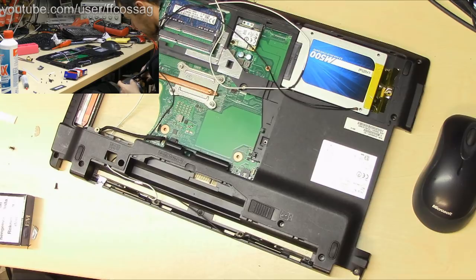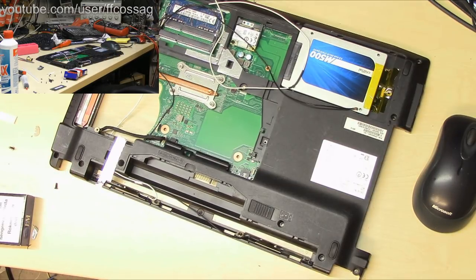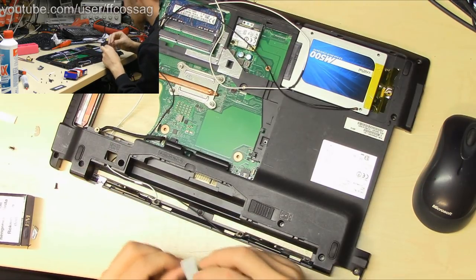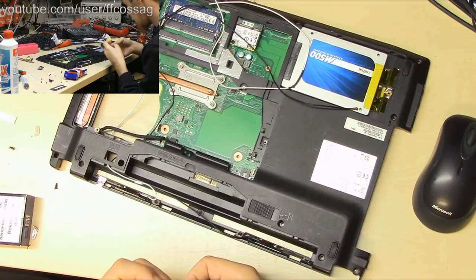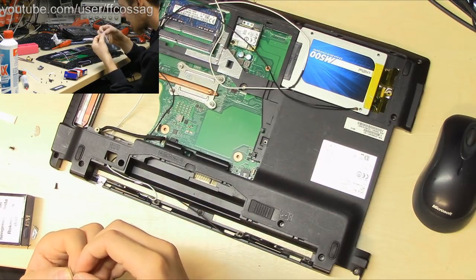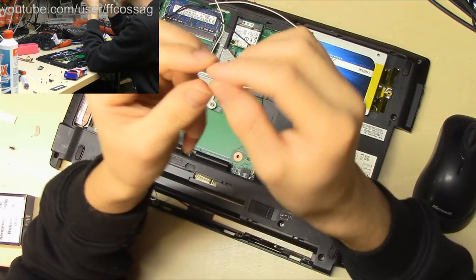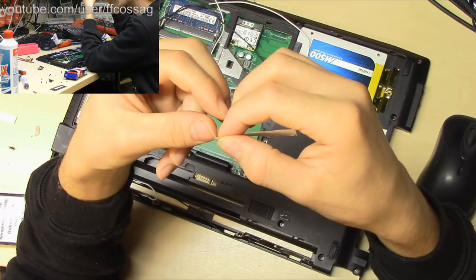The reason I'm using foil tape for this is because it tends to adhere very well to plastics and metals. As long as you have a reasonably flat surface, this stuff adheres very well. And once it adheres, it's going to stay there basically forever. It's much better than electrical tape, for instance, which has a tendency to kind of let go after a while. Kapton tape is good as well. You, of course, don't want to put this on, like, a PCB or something, because it is rather conductive.